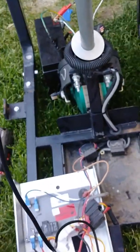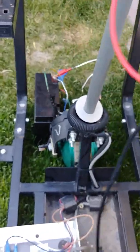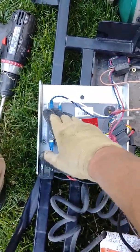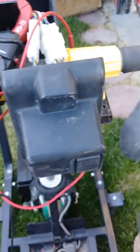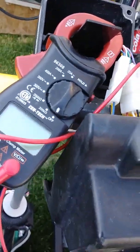It seems like either this computer relay is bad. The horn works — that works — but there really isn't much going on in here. These two wires were disconnected; there's only one way to connect them back, and I still wasn't getting anything. So if the motor is good and I hook these wires to the multimeter — I went from here to there, activated it, and got only 1 volt then 3 volts, never reaching 10 or 12 volts. It seems like the signal goes all the way back into this computer for the relay to kick in, and if the coil is bad, the computer is bad, or the relay isn't kicking in, it's not going to send the voltage through.